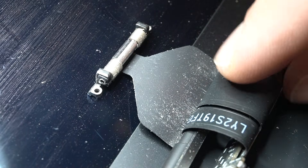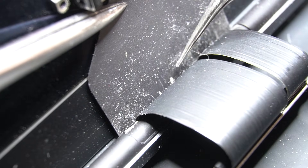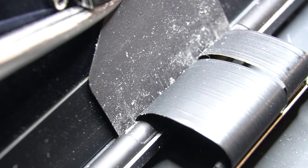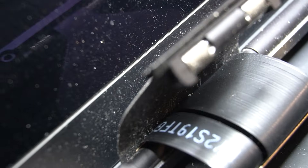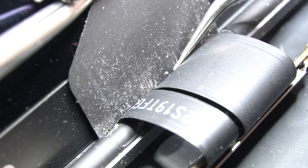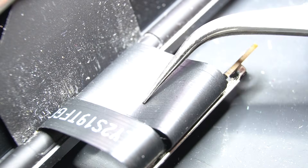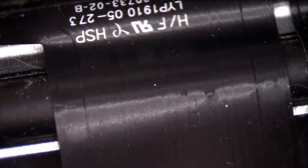The issue is that dust accumulates in the area where the screen's flex cables are located. After time, small dust particles — with the help of the cooler fan and opening and closing the lid millions of times through the years — become bigger, or some sort of micro trash gets in there. This micro trash and dust can damage the thin and fragile flex cable that Apple put in their devices. Even though they add an extra layer of protection, it still didn't help.